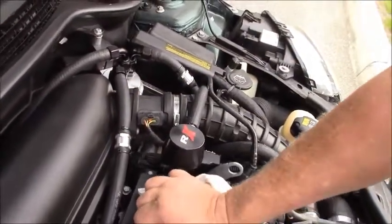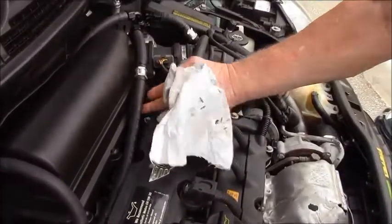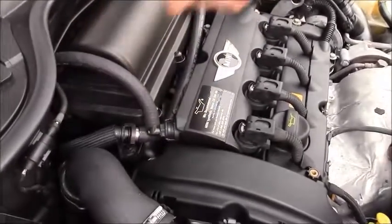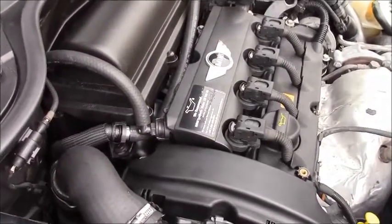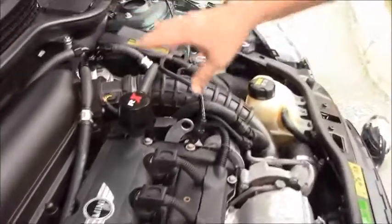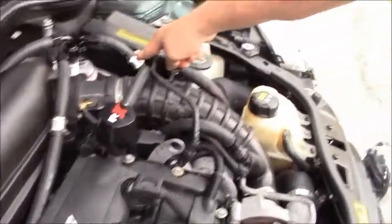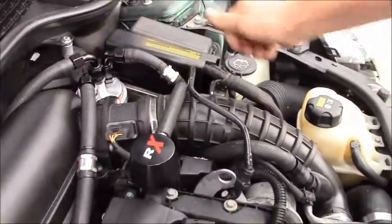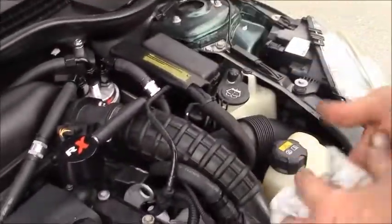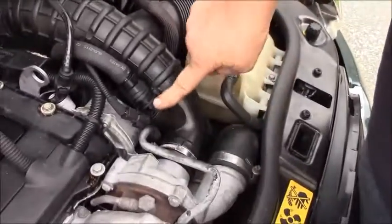And we're using the intake manifold for our primary evacuation when you're in non-boost. Check valve flowing away from the can, going into the intake manifold. As soon as the engine begins to make boost, this check valve will sense the boost pressure and close. This check valve will then open, and whichever evacuation source gives the most suction is where the valves are going to open to, and we're using the inlet of the turbo right here.